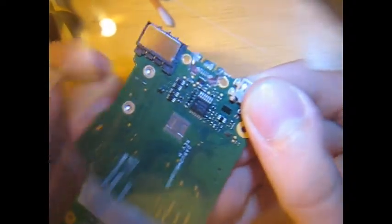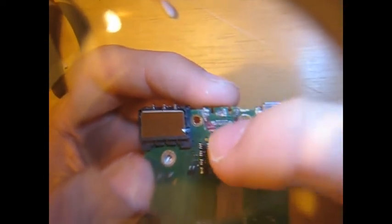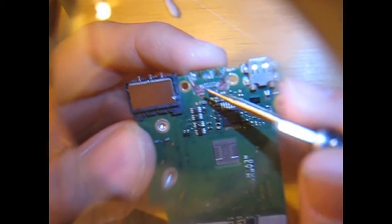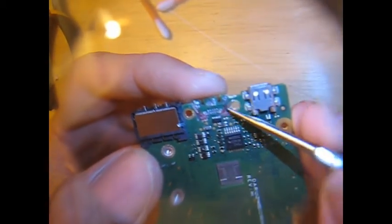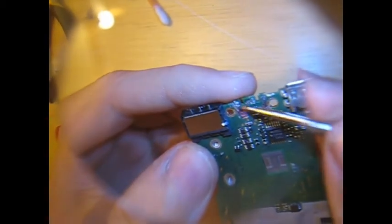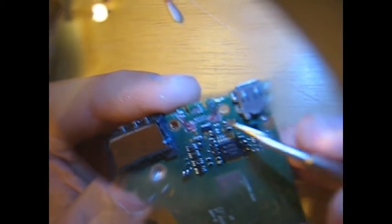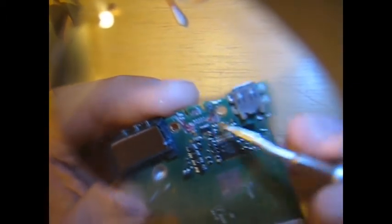Here's the board. As you can see, it isn't the cleanest job — I took the Dremel and you can see where I made the marks. Here are the pins that the USB port makes contact with. There are four holes — one, two, three, four — you can't see them because they're covered up with a little bit of solder. But those are where the legs go in for the USB housing. All it does is you put the legs inside the holes and then solder the legs so they don't move. There's no electrical contact going through the legs — it's just there to hold it in.